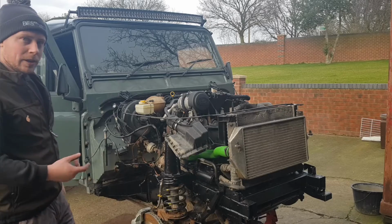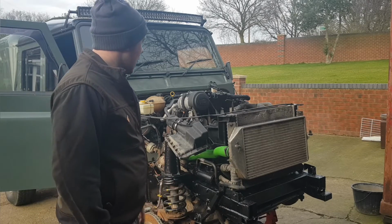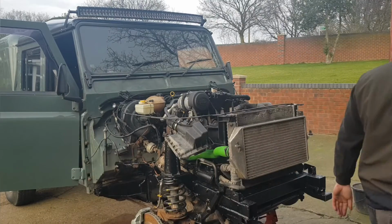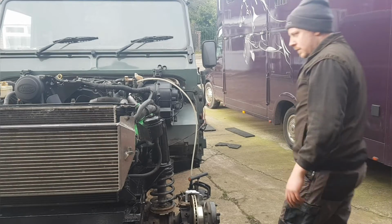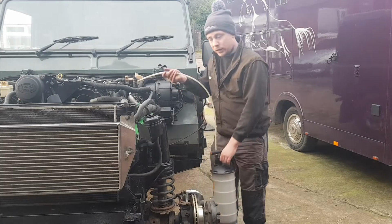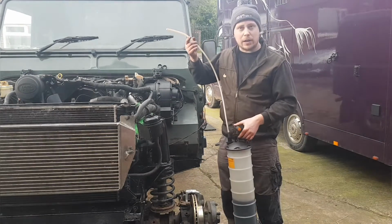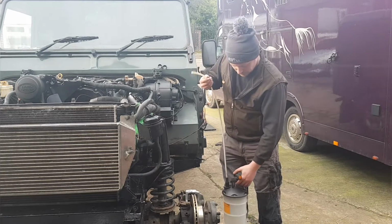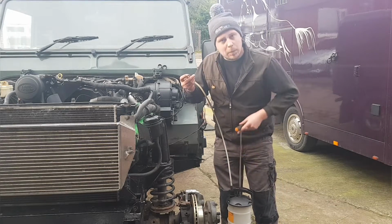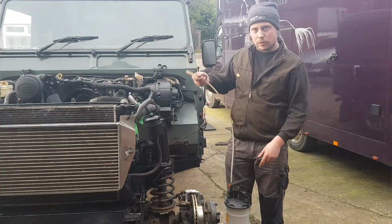Then the change of speed, usually that's when there's oil at the top end, it's in all the bores and everything. So now it's time to bleed the fuel system. So now, while the oil's settling down in the engine, I can bleed the fuel system. Now, if you do a lot of work on diesels, I'd highly recommend buying one of these. What you do, this is the pipe, you put this on the fuel lines, you pump this, and that sucks the fuel through.